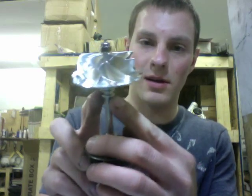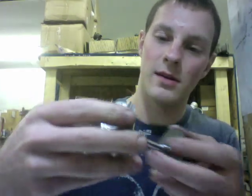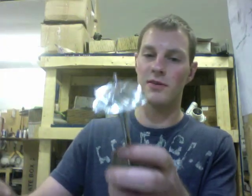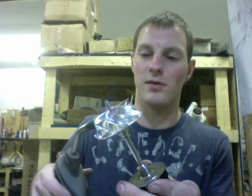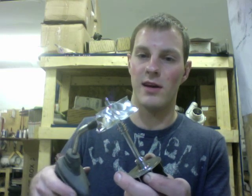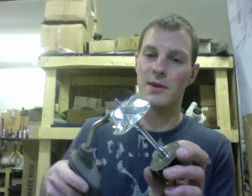The next thing you're going to do is install the thrust hardware. On this assembly, Ian went ahead and balanced it for us — we recently picked up a balancer — and the corrections we had to make were on the back side here. One thing you'll notice, even with the factory Mini Cooper compressor wheel, is that it likes to stick on the shaft. On some turbos they're designed that way, just so that it has a tight fit on the shaft. That's really critical for it to not move, especially when it's in operation and especially if you do a rotor balance. If you heat up the wheel, it comes off pretty easily, because aluminum expands much more than the steel does.